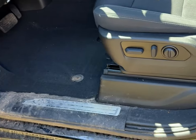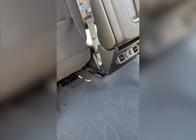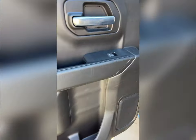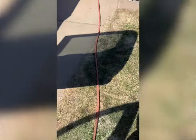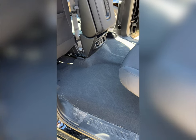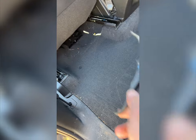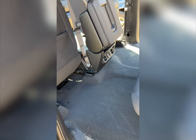After you get all your mats out, slide your seats all the way forward on both sides. Then either vacuum it out or if you have compressed air, take your blow gun — with hearing protection of course — and blow all the junk out. It gets in through all the little areas, especially underneath your seat. Blow it all to the front so you're not fighting as bad with the vacuum.